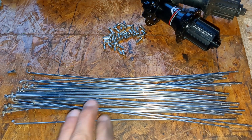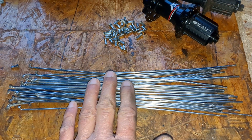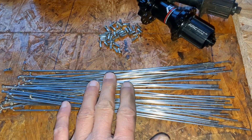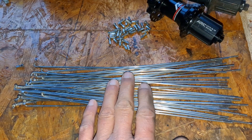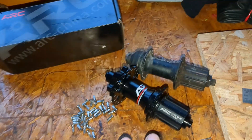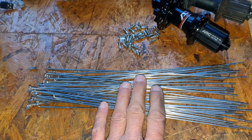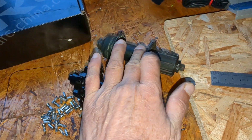Whereas new spokes are an unknown quantity. Even good quality manufacturers can make the odd bad spoke or bad batches of spokes. Of course, even if you use good quality spokes, there's always the chance of failure as fatigue is statistical in nature. There's always the chance that a material will have a microstructural defect in the wrong place or localised damage that will initiate a crack.